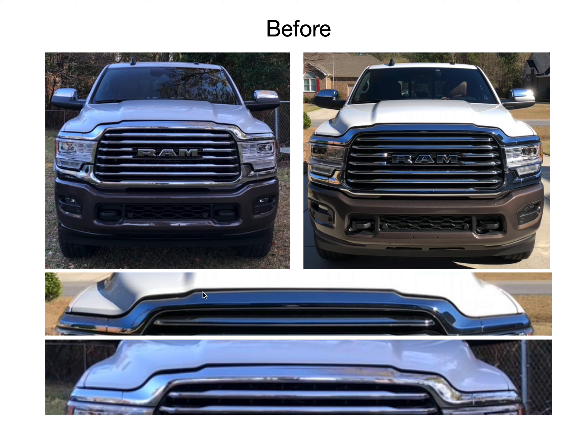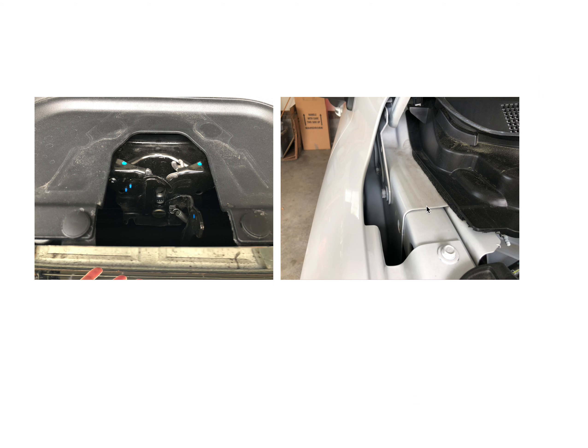I tried many things. The hood stops didn't do anything. I thought raising them would even things out — no. I thought making it tighter on that side with the hood stops — that didn't do anything either. I even adjusted the hood hinges. There are two bolts in front and a bolt in back. I was able to unbolt these and push the hood down a quarter inch on the passenger side and raise it a quarter inch on the driver's side, thinking that would offset the way the hood sat on the grille. That didn't do anything, so I put everything back to the original markings.